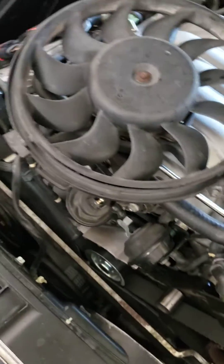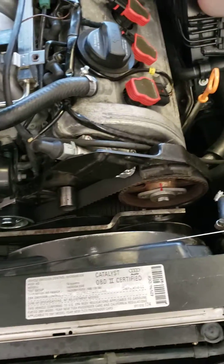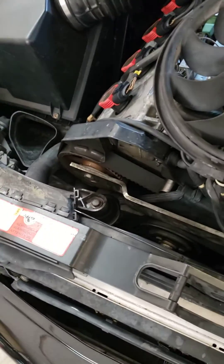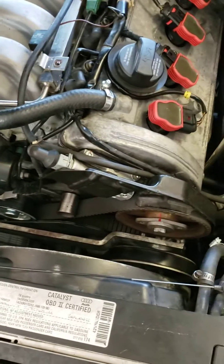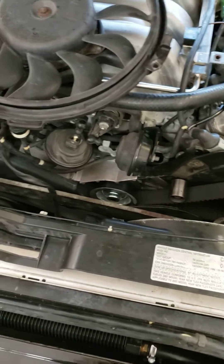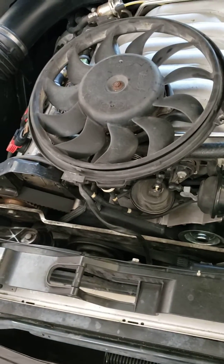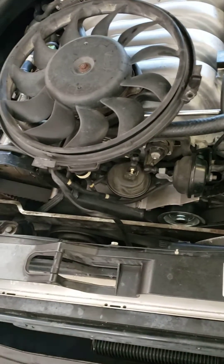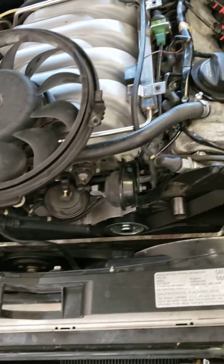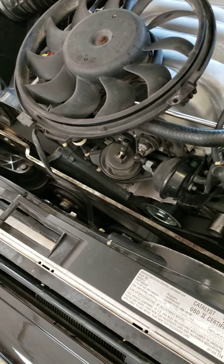It runs great. That's how you can tweak the timing using the cam bar — I've had positive effects with it. My fuel trims are stable. It's not this inconsistency of negative three on one bank, positive four on the other. It's like negative two, negative three — it's plus or minus about one percent. So everything's happy. Take it with a grain of salt.